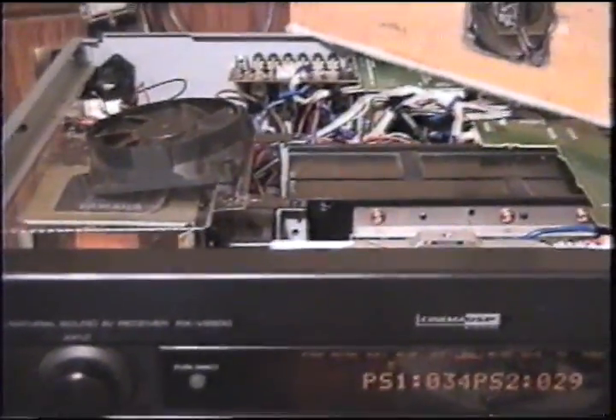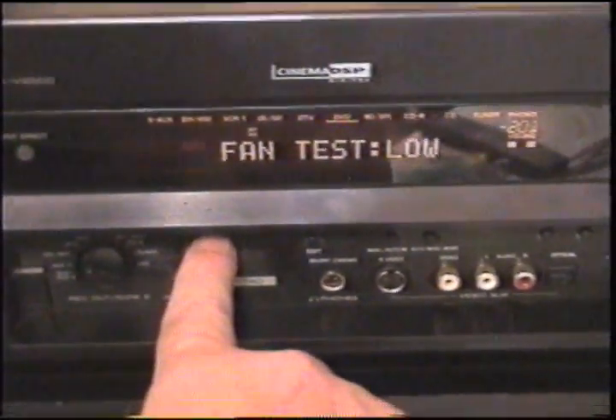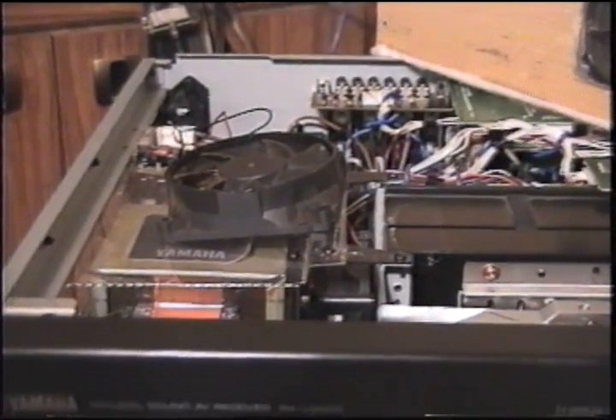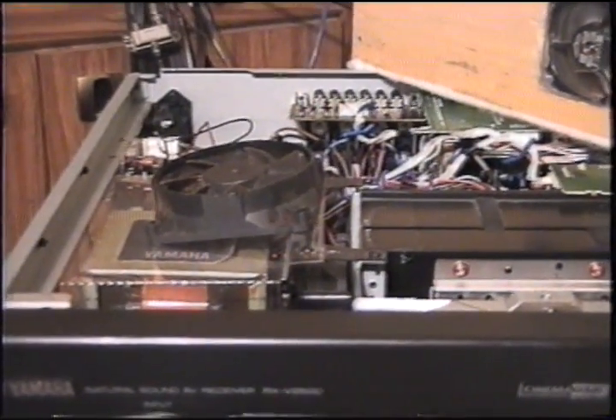I got the fan out of it working and I tested it. I was testing it before and there's a little strange thing going on. When I go to check the fan on low — fan test low — I got this hooked up to check the fan voltage and everything. It should be on low and it should be spinning, but it's not. The voltage is about 2 to 3 volts, which won't spin that fan.